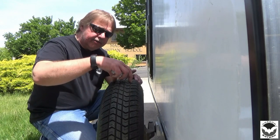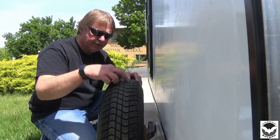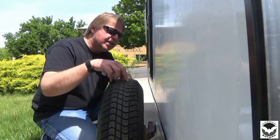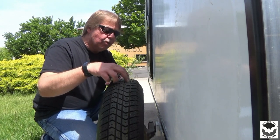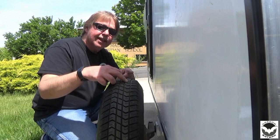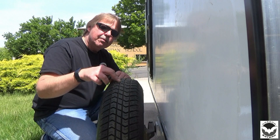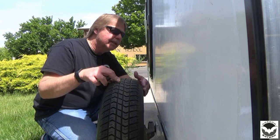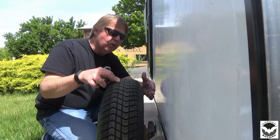Right now these are 4.5 inch wheels with 13-inch tires on them. It's a 13-inch rim. The back space is probably a little over 2 inches, so it puts it far away from the wall. So, I got myself a new set of tires, new set of wheels, with a deeper back set and back space. Hopefully, I'll be happy if I'm 2 inches away from the wall.